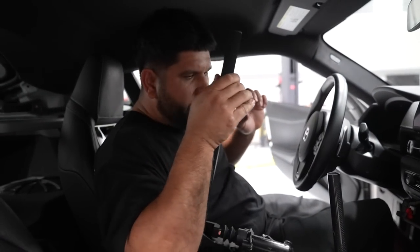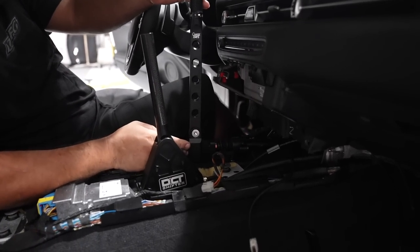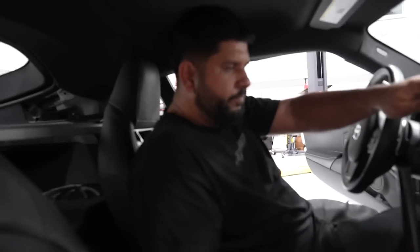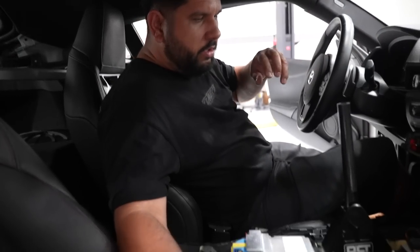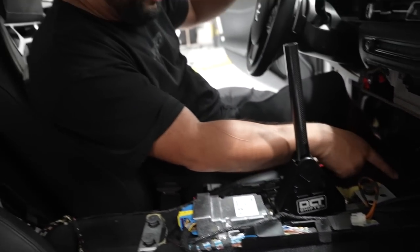While we're doing that, we have this Chase Bays hydro that has the sideways master option. And roughly, we're trying to see where it will fit. Unfortunately, these cars have like a huge plastic carbon piece here. So we're trying to not cut too much of the interior, but we'll see how that goes. So for right now, I have it marked up on the carpet with some gray Sharpie. Let me see if the light comes on. No, no light. So some gray Sharpie. So then we could put a base plate on there and mount the hydro, and then figure out the lines to go to the rear of the car.